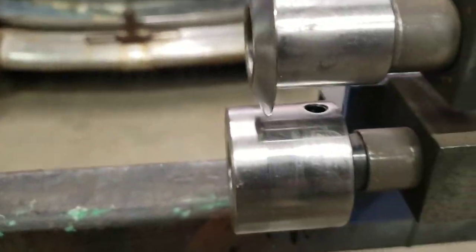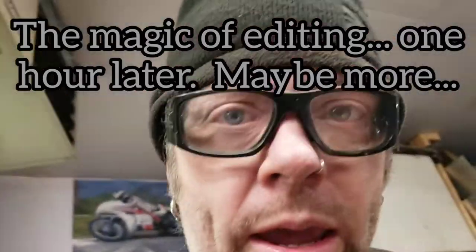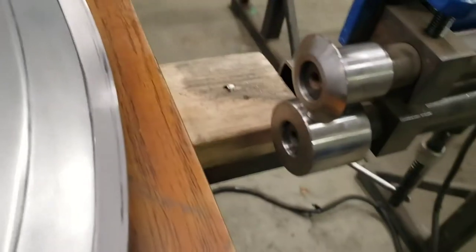I'm going to get to bead rolling now — putting the step die on first, since the tipping die is for later. It'll seem like one second for you but it'll probably be about an hour for me. I'm back — I've got the step roll done, that's my stop/start point, and it came out pretty nice. Then I did one pass top and bottom with the tipping die.